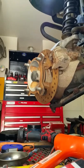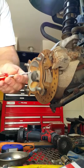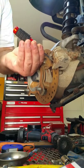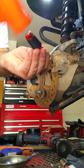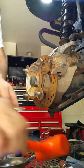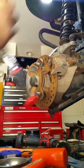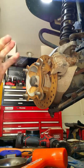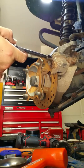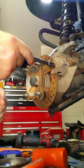All you're really going to need is an old screwdriver or some kind of chisel or punch. You want to wedge it right in there and just tap on it — it'll bend out. Now it's flat. The pin is also a 12 millimeter. I wouldn't necessarily use an impact on these; you don't want to take a chance on breaking them. Those are in there pretty tight, so I'm going to get them loose before I put an impact on.